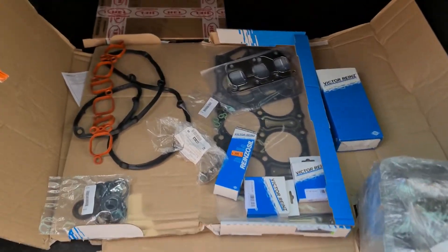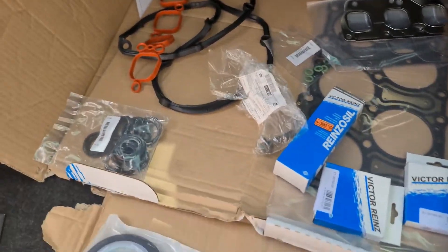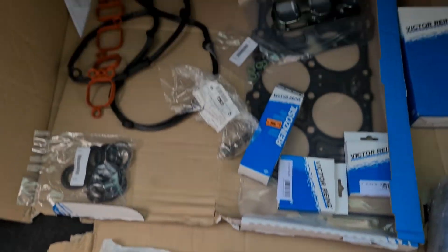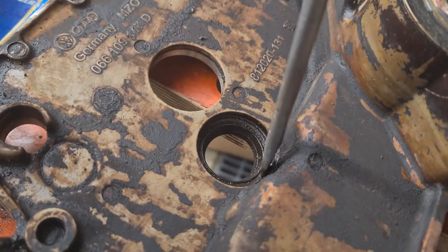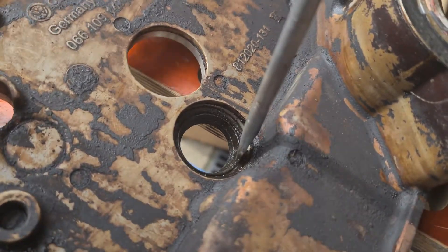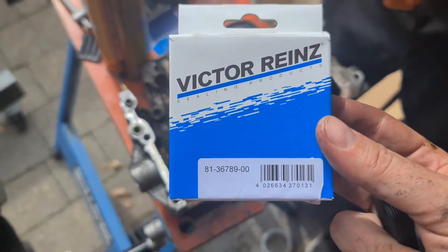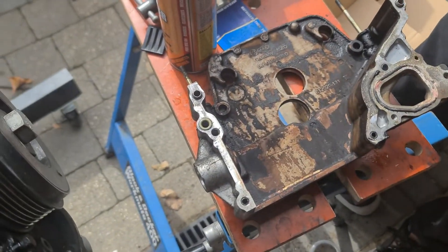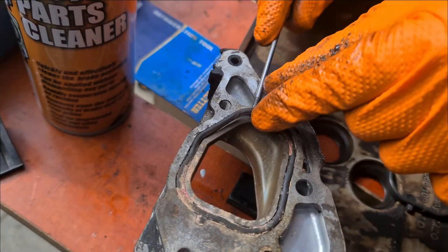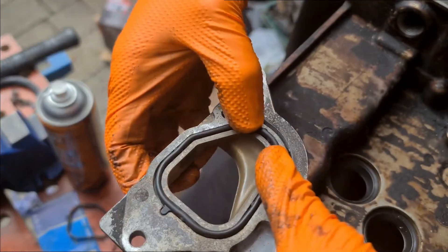As it turns out, the boot of an estate car is a lovely sort of workbench where you can put all your gaskets and seals and stuff before rebuilding the engine. We've got everything in their boxes — we've gone for Victor Reinz, I've heard they're good gaskets and seals. Now we're going to remove the cam solenoid oil seals. We've already managed to remove one and then it should just tap out. We replace them — both are the same part number. We also remove the thermostat gasket and replace it with a new one. This gasket has a little tab so it can't be fitted the wrong way.